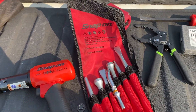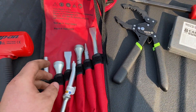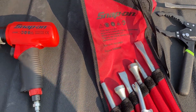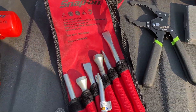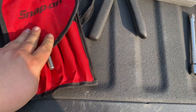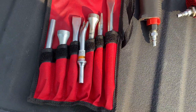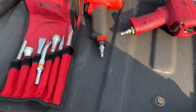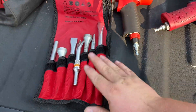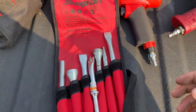As far as the bits go, they've been really good. This one I use a lot for taking the bushings out of anchor pins on drum brakes on semis — you have to be careful not to gouge the sides, but as long as you're careful they come out pretty easy. I know Ajax and Lyle make a special tool for anchor pins too. The bits aren't cheap, but I wanted the lifetime warranty. I've heard stories of cheaper bits kind of blowing up in people's faces, which actually happened to my co-worker — that's why I went with these.